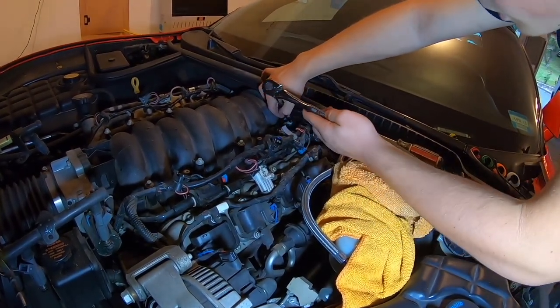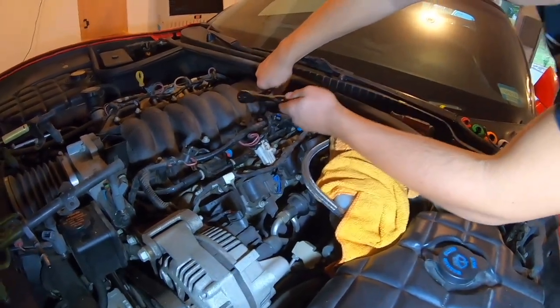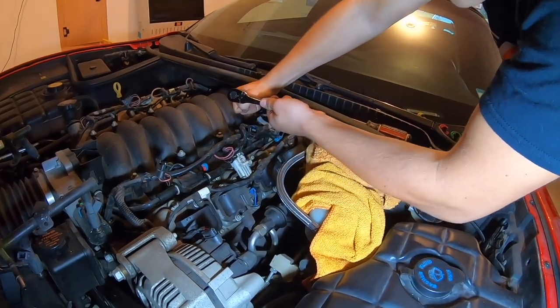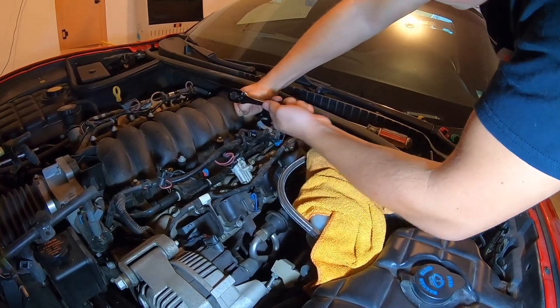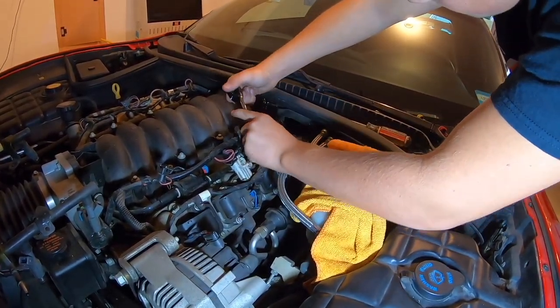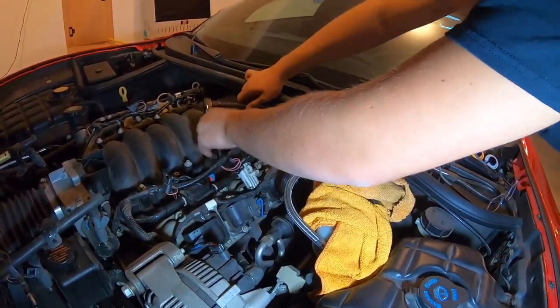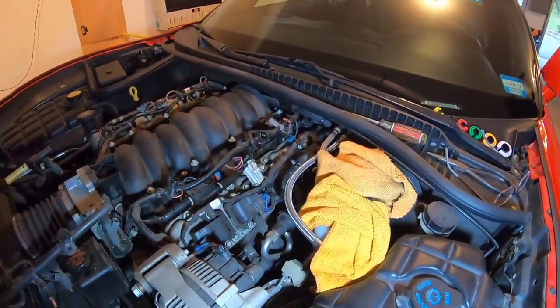We can't get to that oil sending unit. You can't get it off like that, take an adjustable. Yep. Don't force it, because you're going to put a weird torque through it. Yeah, and break the bolt.